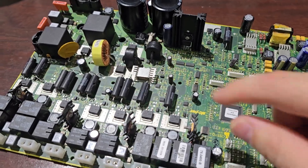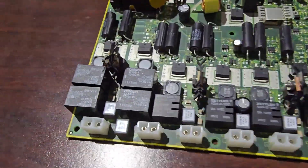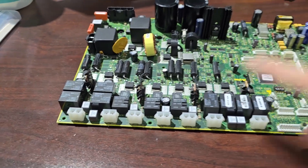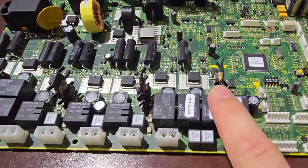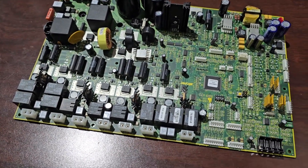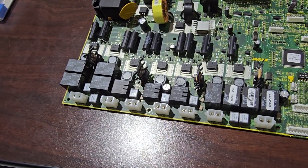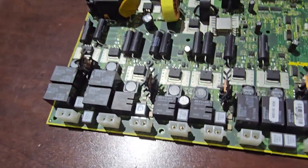When you activate motors, notice all these relays — check those out. Interestingly, it's got double relays. Why would you have double relays? Well, if you want to invert DC, it's going to take two different relays in order to crisscross and reverse the polarity of the leads for a motor, to make the motor run in reverse. That's why we have doubled-up relays. It also helps double the amount of current it can handle, but I believe it's mainly for reversing. So if you have a motor that goes in one direction but not the other and you see two relays near a motor power port, that usually indicates one relay is for one direction and one relay is for the opposite direction.